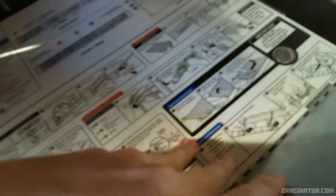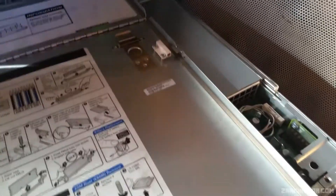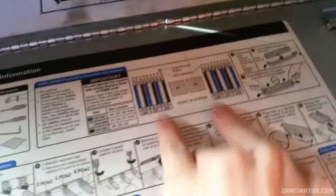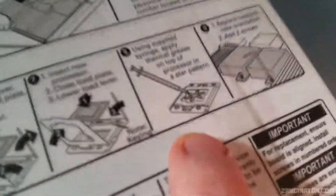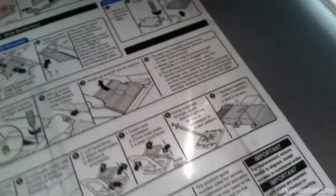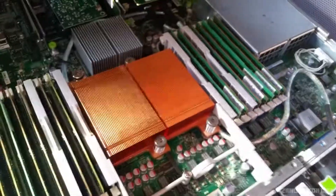To open the full system, press that button down — it says caution, the system will shut down. The reason is it has a magnetic latch system to detect whether the top panel is on properly. On the underside of the lid there is yet another service information reference covering: installing RAM and which slots to use first, PCI card installation, flash modules, motherboard info, and a quick reference for anything you'd want to do. Interestingly they say to apply thermal paste in a star pattern — personally I disagree, as you usually end up applying too much that way, but everyone has their method.